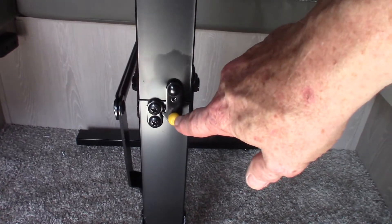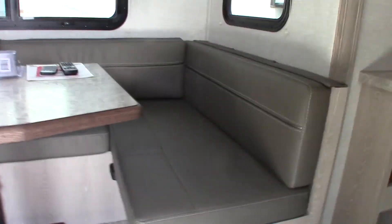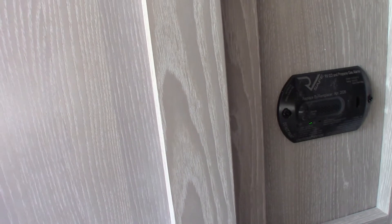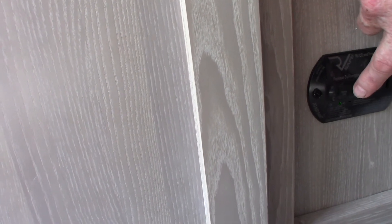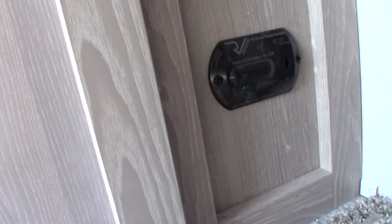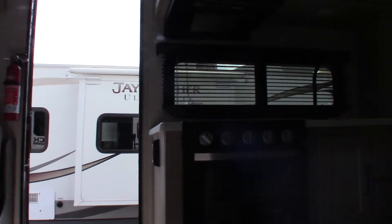This couch also rolls over into a bed. This table drops to a bed — you push this yellow lever or button, latch it over, collapse it down so it's even with the cleats, and fill in the space with the back cushions. This device here is your carbon monoxide and LP gas detector — it should always be green. It will also tell you if your battery is low by beeping very slowly. I'll set off the test: first it tests for LP, then carbon monoxide, then displays four slow beeps for the low battery alarm. If the alarm goes off for real, take everybody outside, leave the door open, shut the gas off, and figure out what's going on. Never just ignore it.